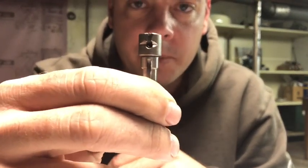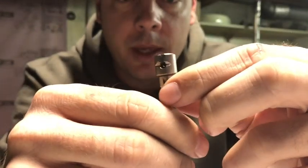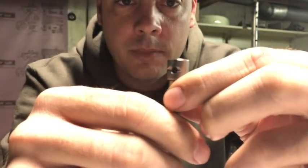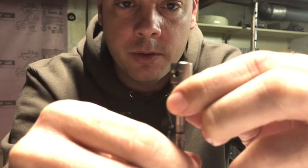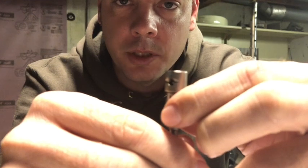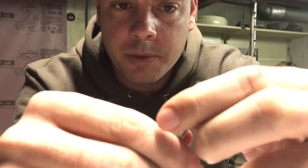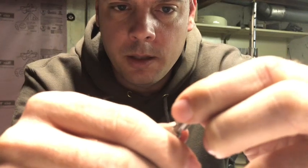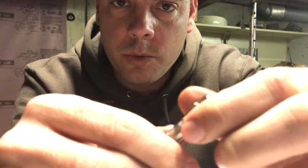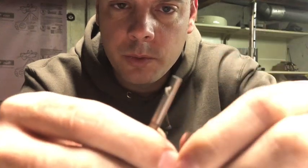On the back side of your barrel and plunger you have what's called the spill port. When the cam goes down and the spring pushes the plunger down, it fills with fuel, and it goes up compressing the fuel, pushing it into the injector when the injector pops off.